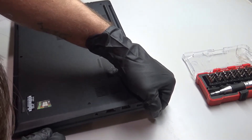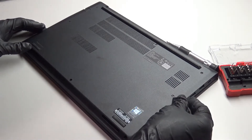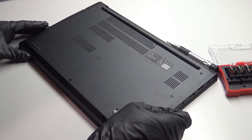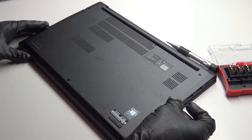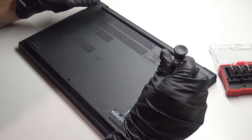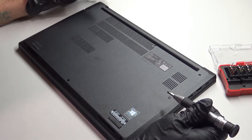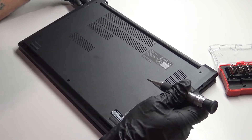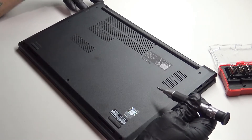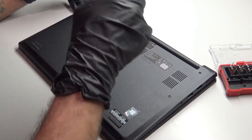I hope that's clicking, not snapping. When prying around the edges, it's very important that you stay very gentle, try to use the plastic as much as you can. And when you run across one of your screws, just in case - because you might think you have it all the way out, and I really did, because I did hear some clicking - you back it out even then, and you just gently apply pressure right next to the screw. I've got the case off, but you gently apply pressure right next to the screw and back that screw out of there.